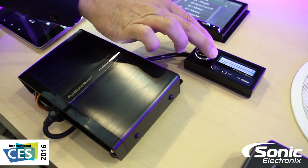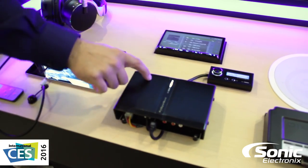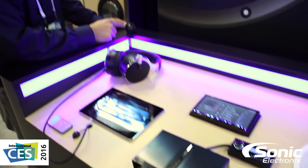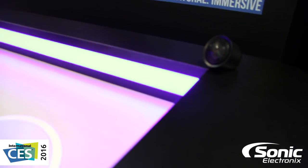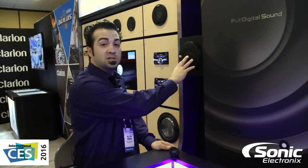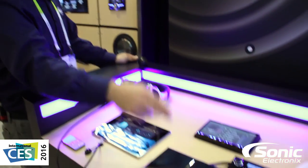This is the outboard controller for it. They have two proprietary LSI chips on board the Z3 processor. Those two chips are digitally sending signal to the tweeters that come with the processor — there is no amplifier whatsoever. Then you have the sold-separately six-and-a-half inch mid-ranges that have the LSI chips built onto them. Essentially, all you're doing is running power from the full digital system to the speaker, so it's digital the whole entire way.